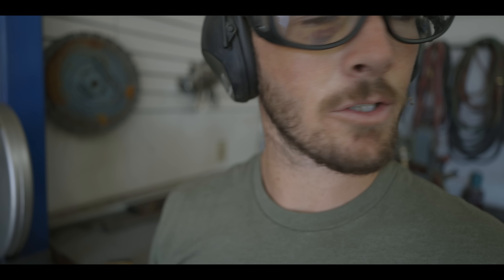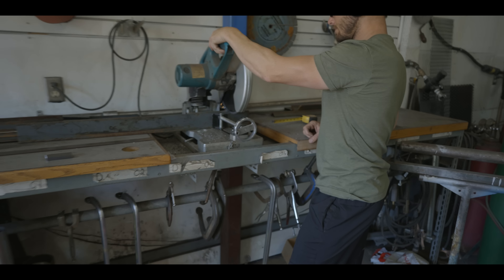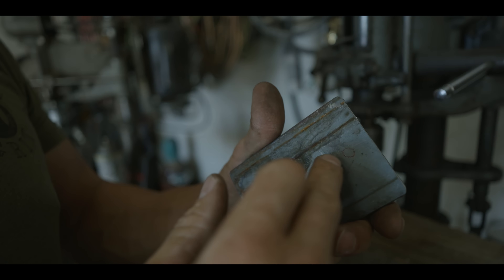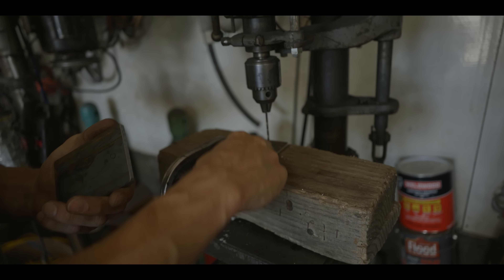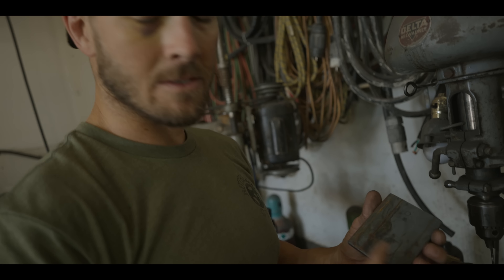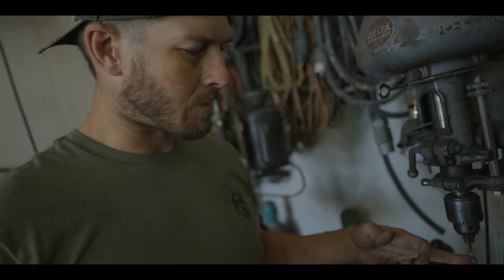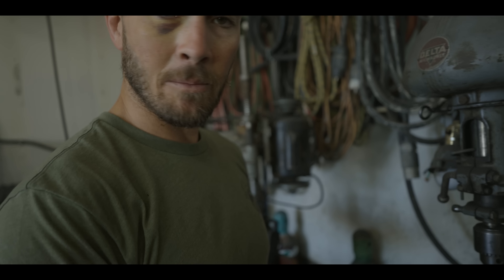This is a piece of quarter inch by three flat bar, cutting it four inches long. I'm going to round the corners on the front — that's what's going to get welded to the bull bar. We're going to drill a half-inch hole in it, and those big lights are going to get mounted on there. We'll paint it afterwards so it doesn't rust. This back side gets welded to the bull bar. This is just a pilot hole — we'll drill that first and then step it up from there.